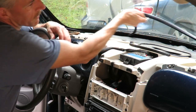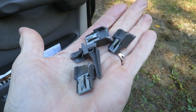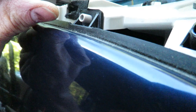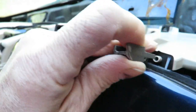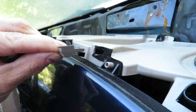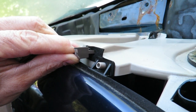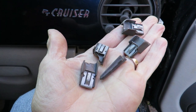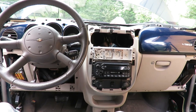Don't get that weather stripping out because we're going to want it on the dash piece before we put it back in. When you try to lift up the dash to take it out, all these little tabs slide into little black pockets along here — they slide straight out this way. Not quite sure how to do that without breaking them. That's the way they have to come out. If you try to lift up the dash at all, like I did the first time, you'll break them. Okay, it's all ready to come out.